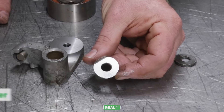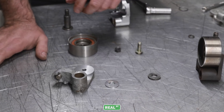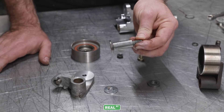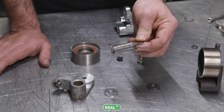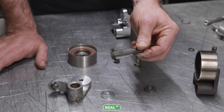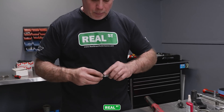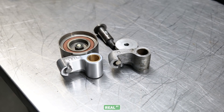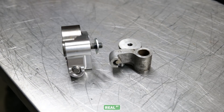Also make sure this bolt is not bent — it can bend over time or with misuse. Put it in a drill, spin it, and make sure the bolt is still true. You do not want to reinstall it with a bent bolt. When you put this together, put a little bit of anti-seize on the collar of the bolt, slide it together, and use the OEM Toyota washer.